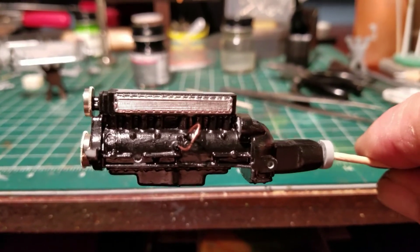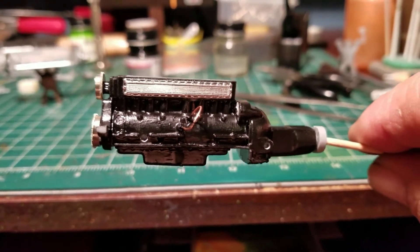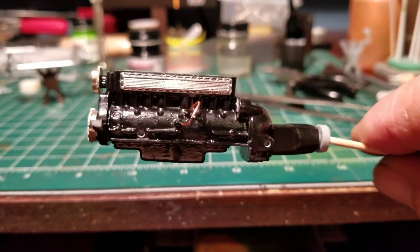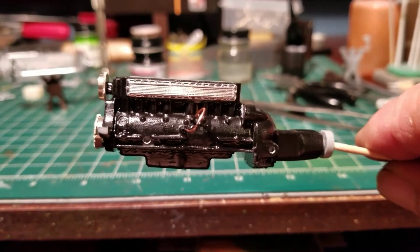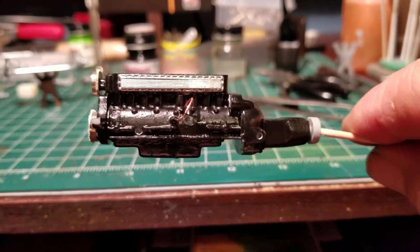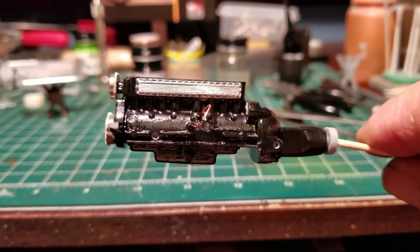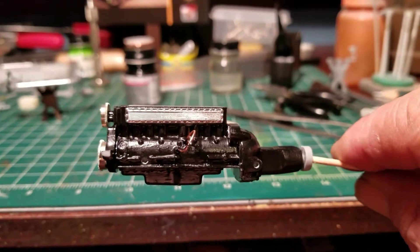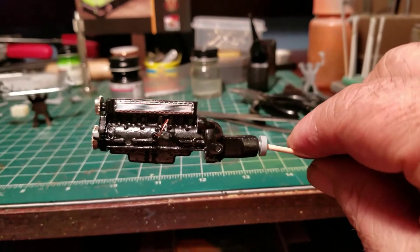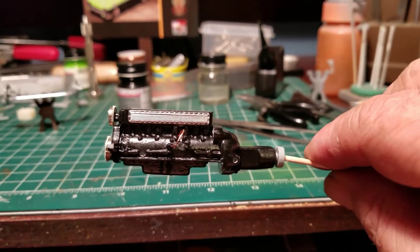You may not be aware of a spinning oil filter. When I worked for the town we had a couple of trucks that had those. The oil goes through it and it just spins — all the debris gets thrown to the side. When you open it up there's like a quarter inch of gunk all around that you gotta scrape out. No cartridge filter in it. I think it was called a centrifugal filter, if I'm not mistaken.